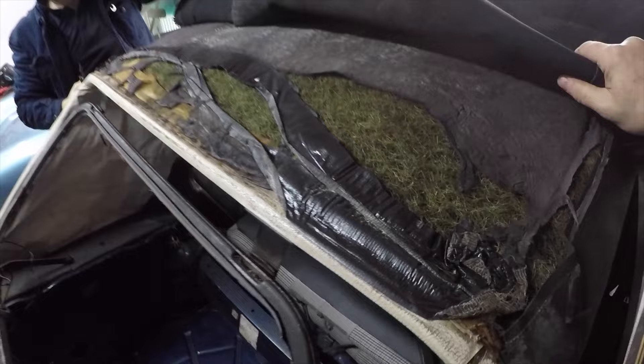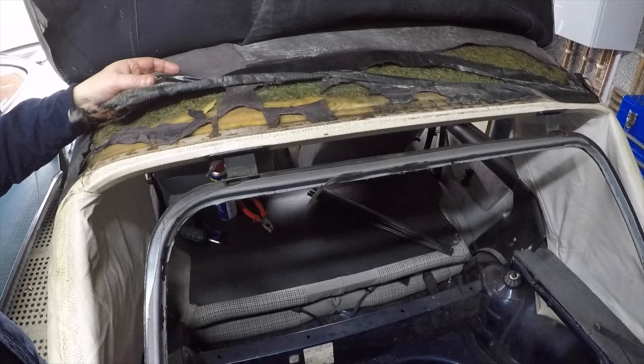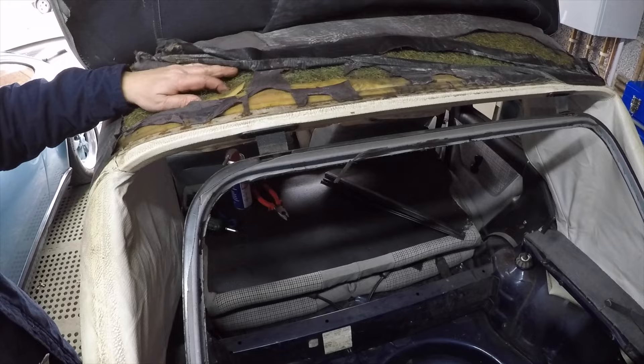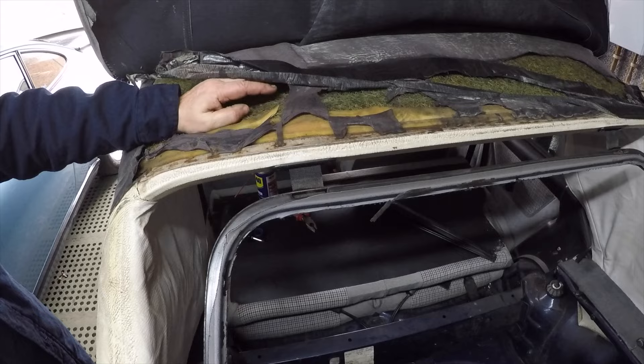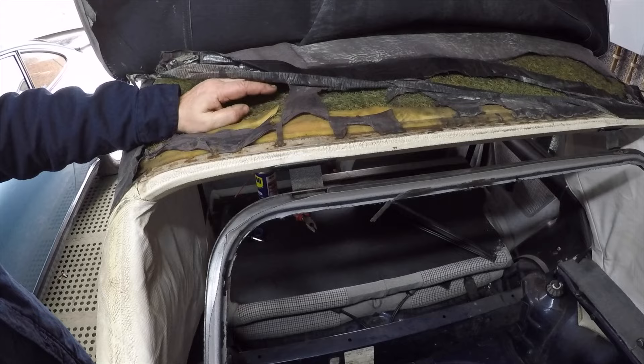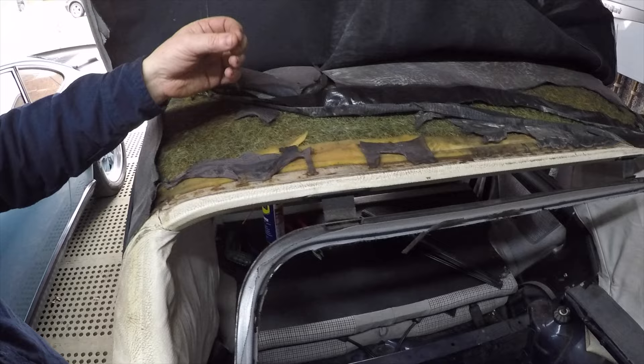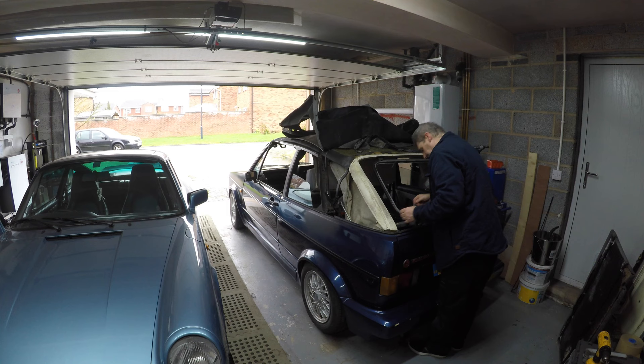Oh my word, look at that - that's attractive. This is your interliner and your padding. Obviously someone's tried to attempt to repair this with gaffer tape. But basically what happens is the capping sheets tend to rot and fall apart, and the padding - this is a rubberized horsehair formed into a sheet, with latex rubber that it's all mixed up with - and over the years, like rubber does, it tends to decompose, it rots, and therefore your padding falls apart. So if you find little bits of straw and grassy kind of bits and pieces on your parcel shelf or back seat, nine times out of ten it's going to be your padding falling apart.